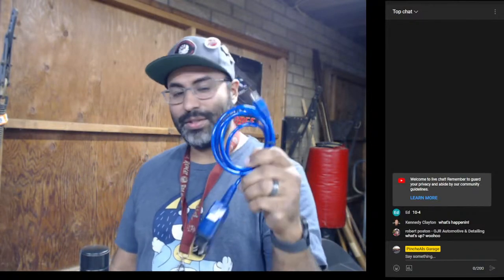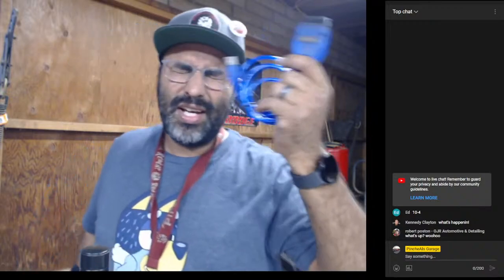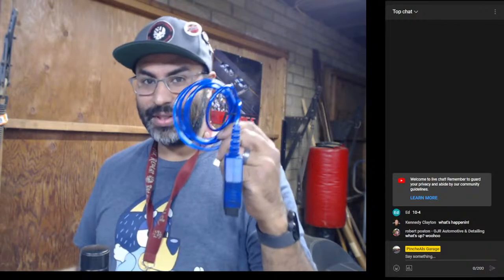It's super cool. You just need an OBD2 cable, USB. Make sure it's one of these VAG KKL cables. These are not authentic. These will not use up a VIN number or use really in-depth functions with VCDS. But with this, and if you have a laptop and the internet, you can download VCDS. It's 100% free for VCDS Lite. This cable right here is 20 bucks on Amazon, plus the VCDS, which is free, in a Mark IV in general.